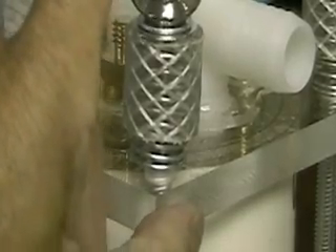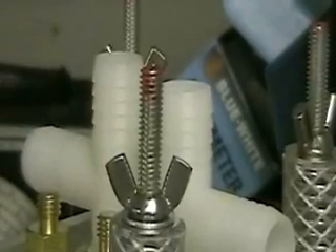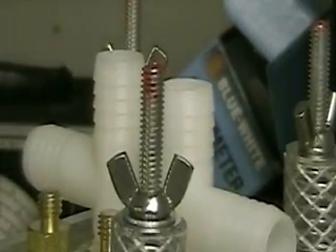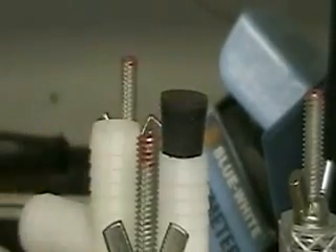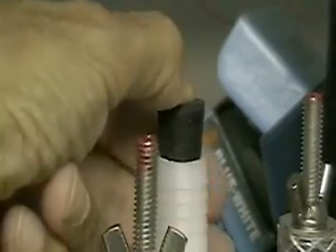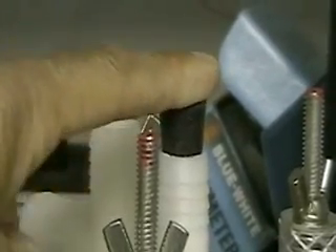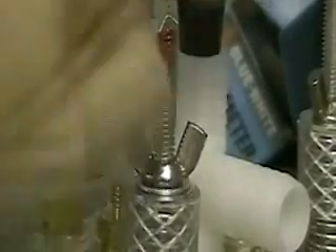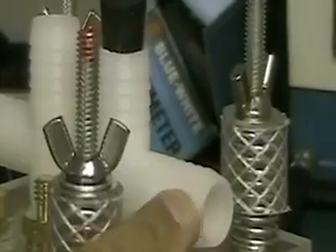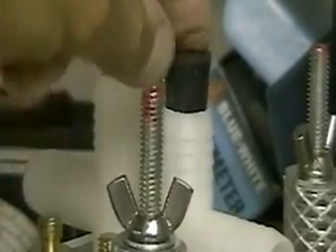It allows the pressure to come out. Also, remember these here — what you do is put simple plugs in here. You don't have to do that; you can close them other ways. The system in my car right now, the cell in my car, I use this to relieve the pressure. I've got all these tubes, except for the ones obviously going to the intake manifold, with these plugs on them. So if there's any backfire, any pressure back, these blow off.